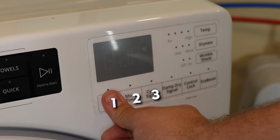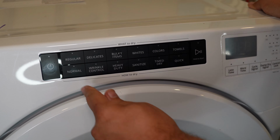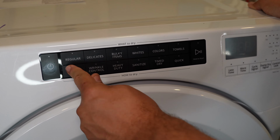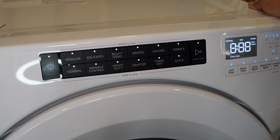One thing I noticed when filming this was that if I tried to press the sequence a bit too hard, it seemed like it didn't want to trigger. Having said this though, power cycling the unit again helped me put it into diagnostics, and the machine seemed a bit more responsive when I used a lighter touch.